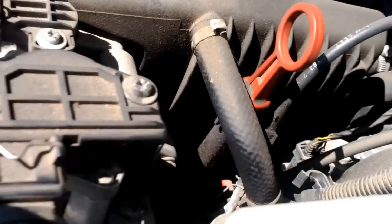You'll be able to find out where that is if you wrestle off the hose clamp and get that hose off, if that's going to be a problem. But you can clean this out with some carb cleaner and a q-tip if you don't want to rip apart the throttle body and all that stuff, just to see if that helps your idle problems.